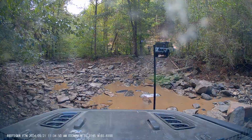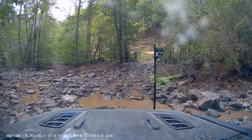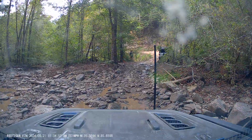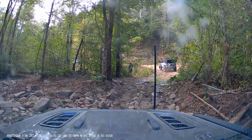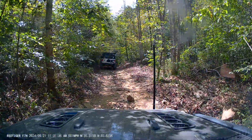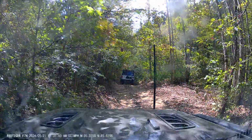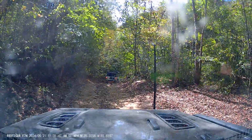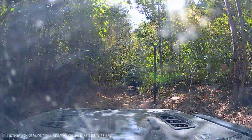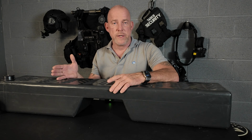It's a 21-gallon tank, and one of the things I really like about it is it has baffles in the tank, which cuts down on a lot of the sloshing of the water, which really becomes an issue whenever you're cornering or you're out on the trail and you're taking a lot of tight corners. The only problem with 21 gallons is it's 168 pounds of water, where the 10-gallon tank was about 85 pounds because it's about 10.5 gallons. So that's quite the weight difference in the vehicle. But whenever you allot for that, it's not that big a deal.